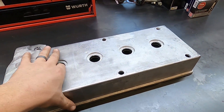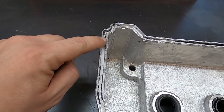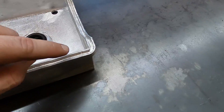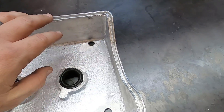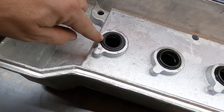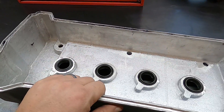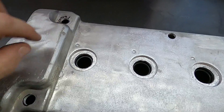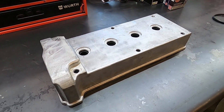Alright guys, it is all machined and ready for some test fitting. I was able to re-machine this groove for the gasket so it can use an OEM gasket. It was a fair amount of work — a bit tedious in certain spots, doing it manually with a conventional vertical mill. But in the long run I think it was totally worth it; it ended up working out well. I also was able to machine these little pockets so it could accept OEM seals for the spark plug tubes. We've been test fitting it to make sure all the holes are in the exact right spot so we can bolt it down.